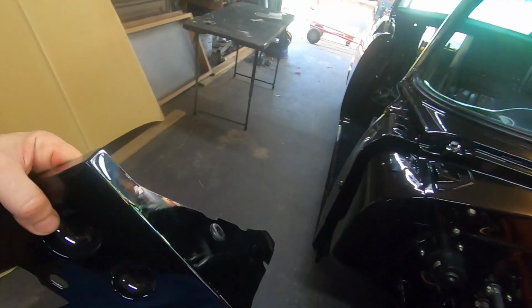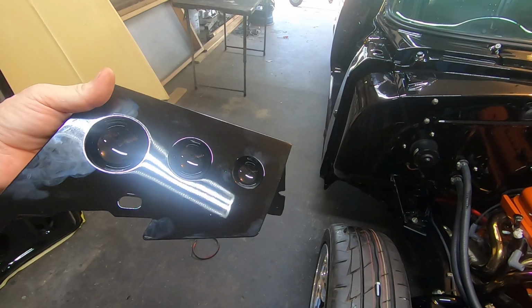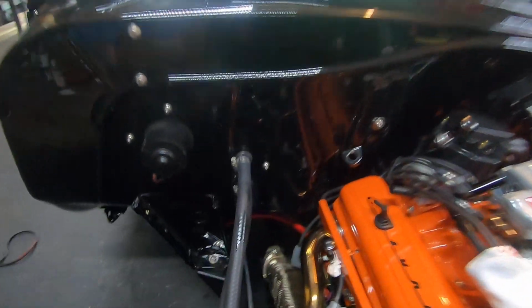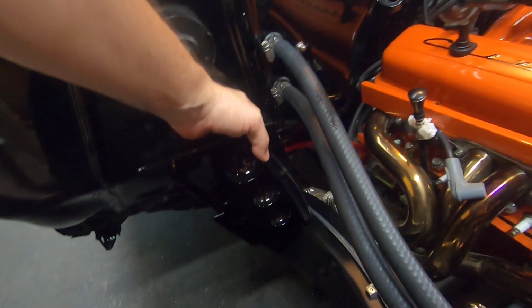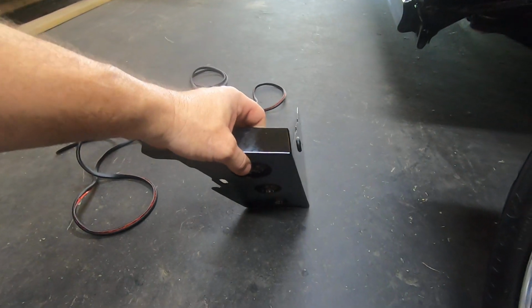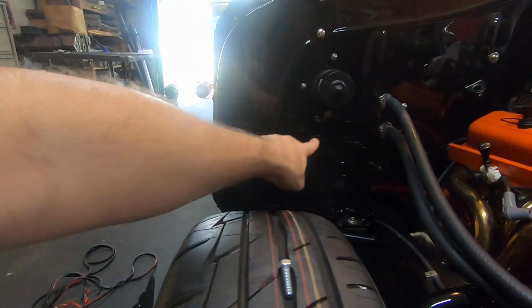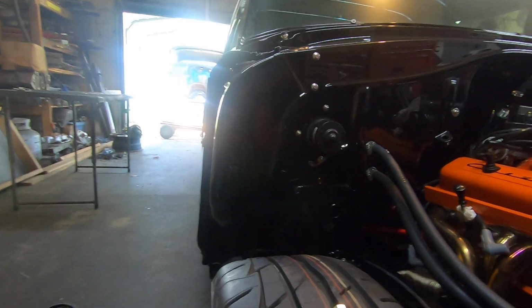But I made it all out of flat pieces. I used a hole saw and pipe caps, and I stepped them large to small, which gives it a speed hole look. I put a rubber grommet in there for my main battery cable to pass through. These will go on here and bolt on. I still have to color sand and buff these, which is why I haven't attached them yet. I've also got my original attaching hardware for the inner fender that bolts on there, and I've notched that cover out with an oval hole, just like it would be. I've got this rubber welting that will go on the edge, and that'll keep it from scratching, chipping, or rattling on the firewall. But anyway, that's how I did my body mount covers for the front here.